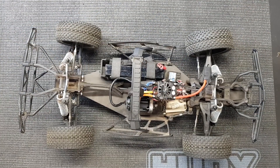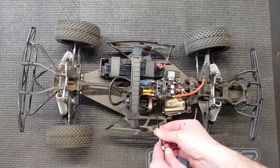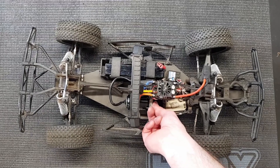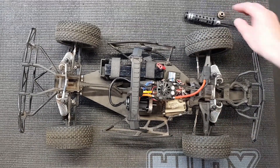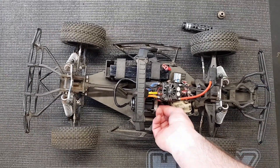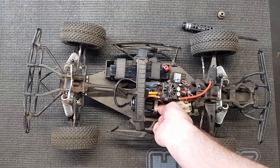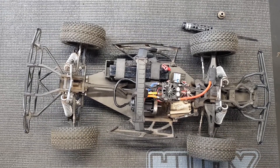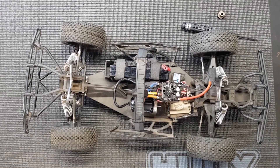What I'm going to do first is just remove the pinion — using a 2mm driver, take the pinion off like that. The transmission runs okay, but the motor doesn't turn, so obviously there's a problem with the motor. We're going to take the motor out and see what the problem is. Just need to unsolder a few wires and undo a couple of bolts, so we'll be back in a second.